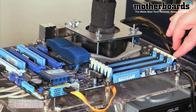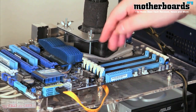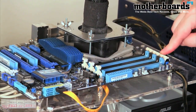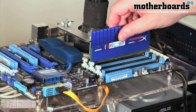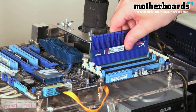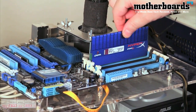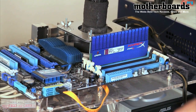We've opened up all the memory slots. I'm going to install the memory a little bit away from the cooler, using these blue slots — they're just different channels. You find the matching slot, insert the memory, and make sure it's firmly locked in place. Once the memory is fully locked, you know it's installed correctly.